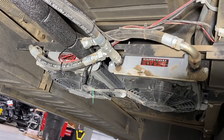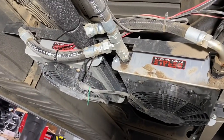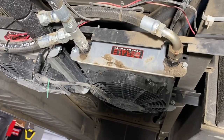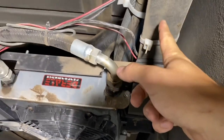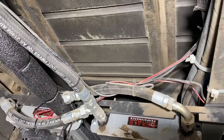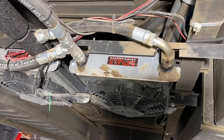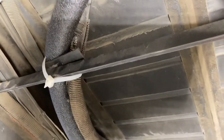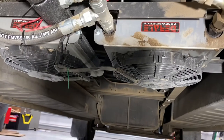It's sort of hard to see under here and get a good angle, but I'll put a couple of pictures in as well. I took a couple of L-bracket pieces of steel and ran them between the two frame rails on my Holiday Rambler. This whole area between the frame rails is pretty much open, with the exception of the fuel tank and propane tank, so this made a good spot. I put a third L-bracket for extra support since I didn't like how far the hoses were going to go unsupported.